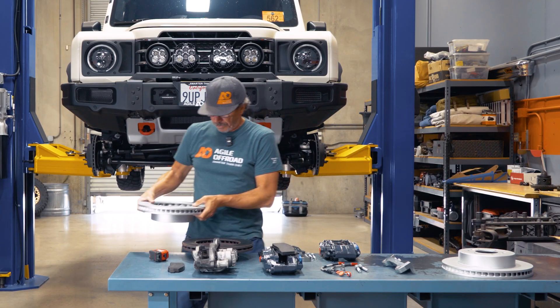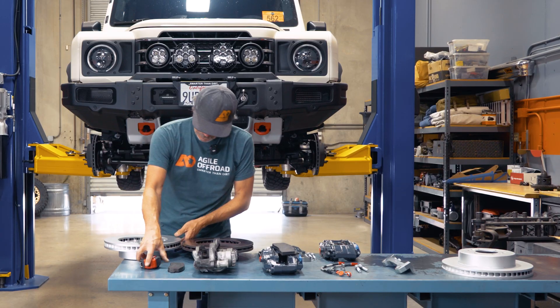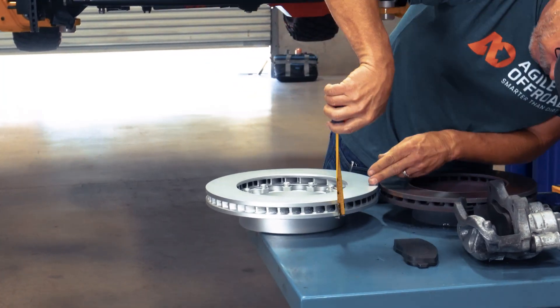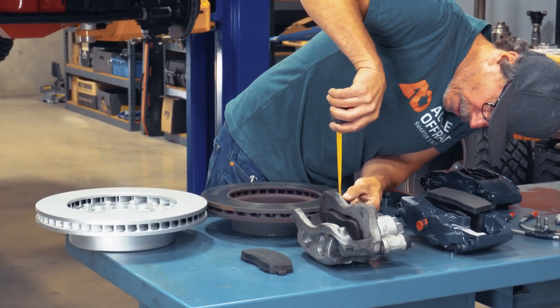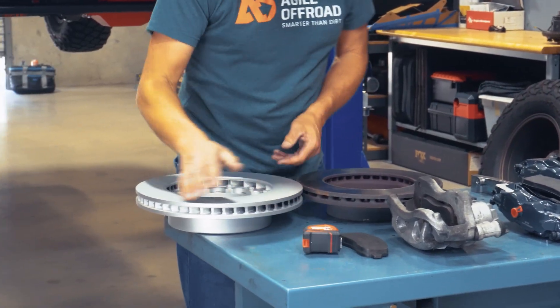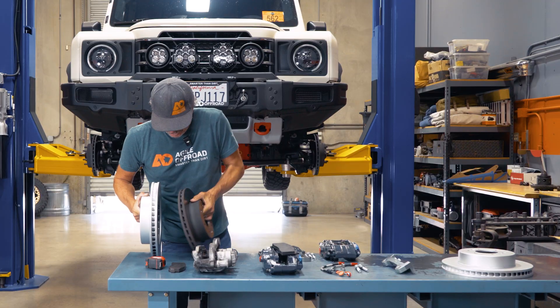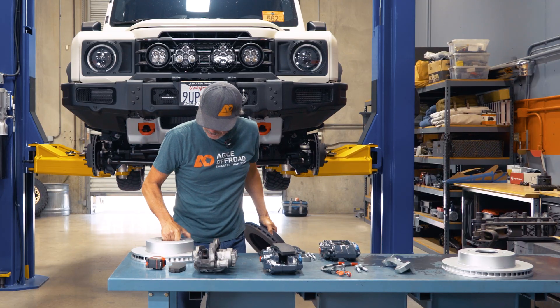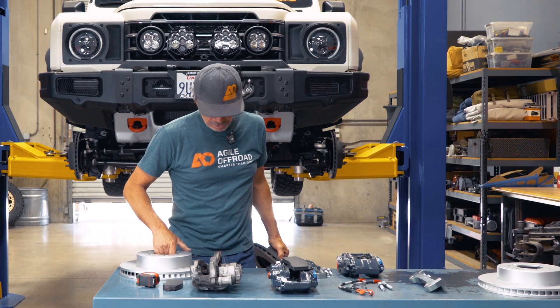You can see here the rotor and how much bigger it is. We've also got a little more width on this rotor — it's an inch and a quarter, versus the factory rotor which is just about an inch and an eighth, maybe a little shy of that. As we know, leverage is key: as we get that clamping force further out on the wheel, we get much higher braking force.